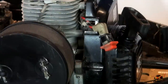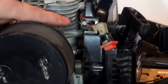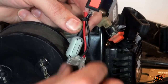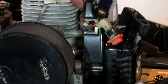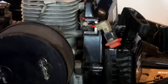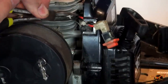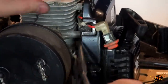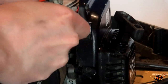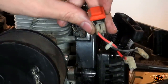Here is that switch I was talking about. There are the two leads that actually go right inside — one, two. Polarity and position don't matter. It's not the switch itself I want to swap out; it's this whole piece. I have to reconnect these pieces on the inside — they're just like little boots. So I'm going to take a set of needle nose pliers, go in there carefully, just kind of wiggle it up to the top. There's one, and then the other is located just on the inside of the shroud. Just like that, it is removed.